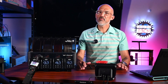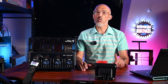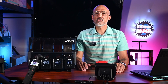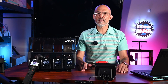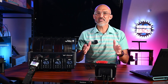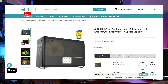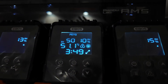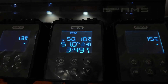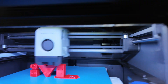The thing that really sets this apart from other filament drying solutions is that it works with your existing original AMS unit to give you drying capability while you are printing. Other filament dryers require you to unload your filament, load it into the dryer, dry it, then reload it into the AMS — you can't do a multi-color or multi-filament print using any of those dryers. The second stage drying mode allows for optimized drying and printing: use the first stage to thoroughly dry your filament, then during the second stage maintain a slightly lower temperature to support stable filament feeding and printing performance.